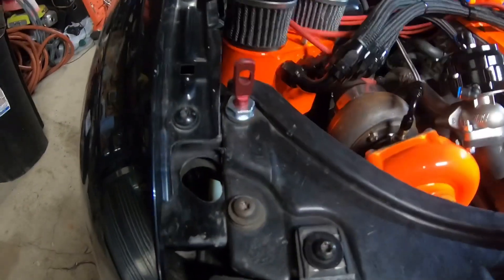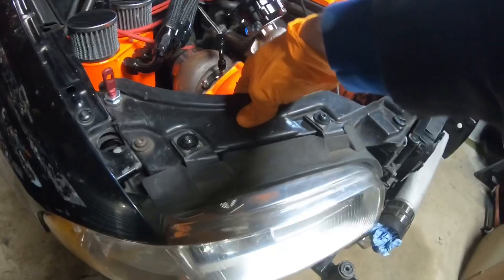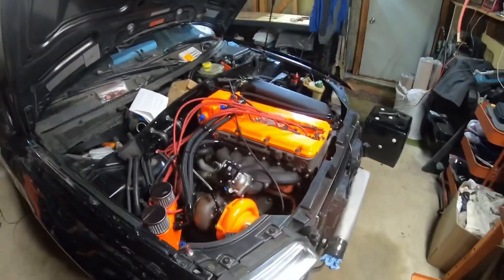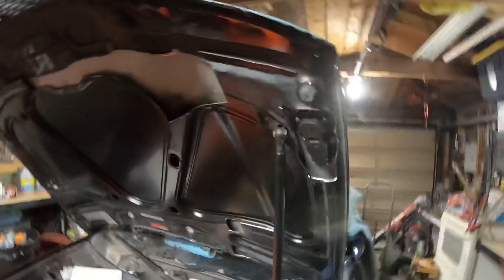So this is how it looks: basically there's a screw over here, and there used to be a screw over here also, but I basically re-drilled it to make it bigger so this fits perfectly. I was supposed to put it right in the middle but the support wasn't good there, especially after I cut this apart to fit the VR6 in here. So I had to grind this off and it actually fits good.